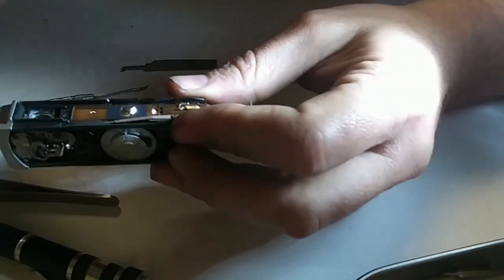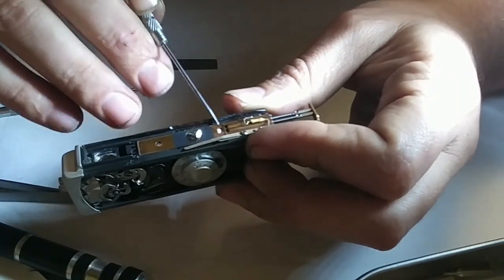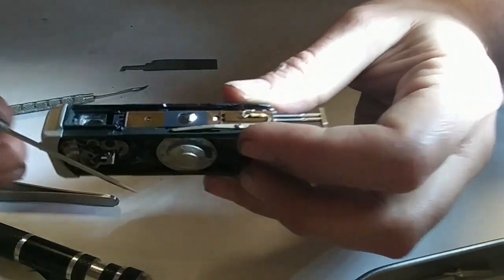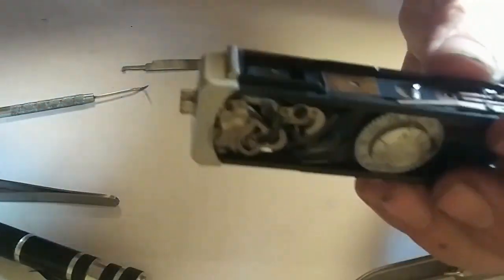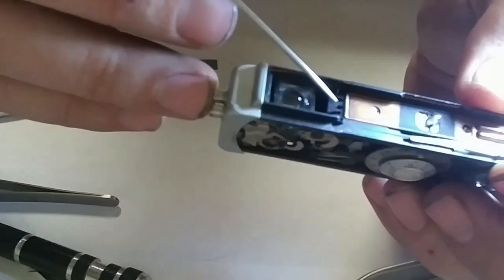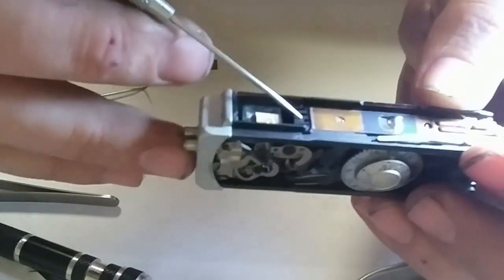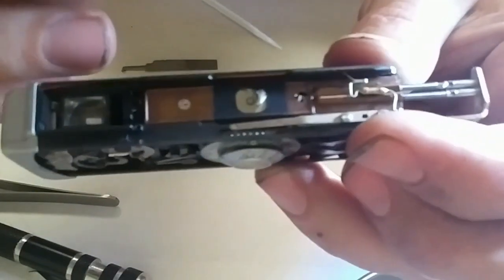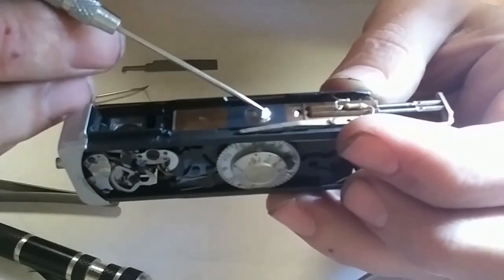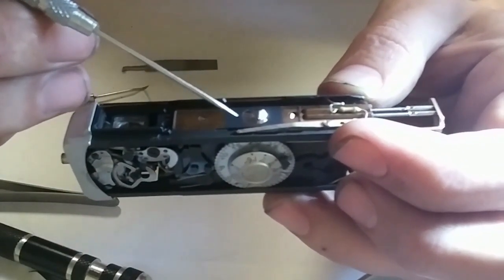So what's holding me up is I remembered that in these two holes, I think one of them has the screw holding down this copper housing that holds the blades. I've been messing it up a little worse than it was. These are where the two shutter holding pins or release pins poke out, and the little tabs were all crunched up in there. This hole right here, you can see they're all crunched up. The only way I've decided I can get it out is to try to pull it through the lens hole. And I'm hoping if I can get one blade out, it'll be slack enough that I can fight the second blade out the normal way.